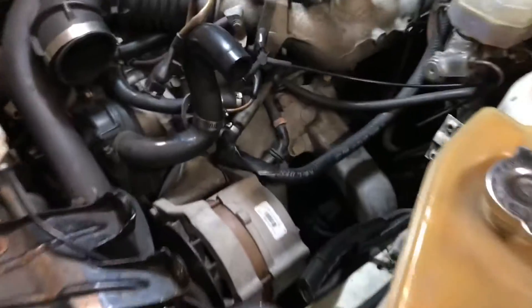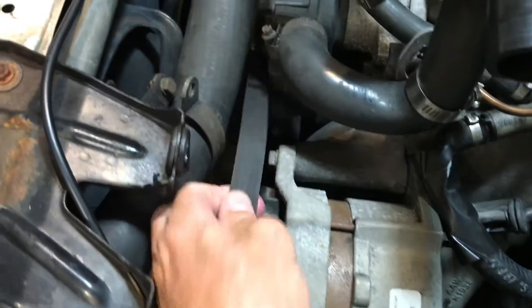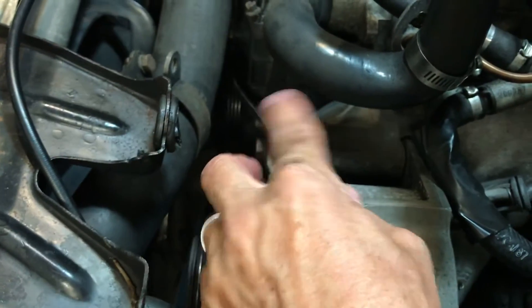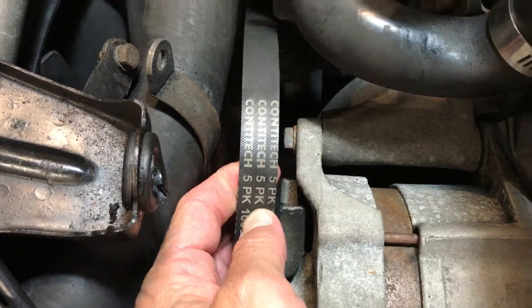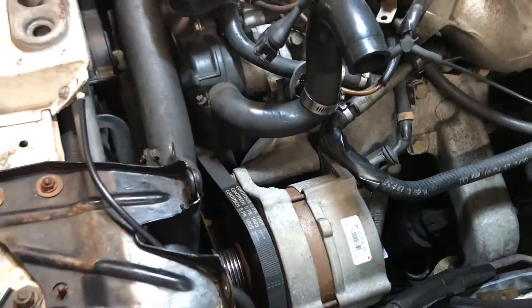I'm going to do it because I need air. Down here underneath the alternator, you've got the serpentine belt. You have to check the ribs of the belt — this one has a number on it. The thing I want to say is: on your 924S, when you put the belt on the cam pulley, make sure it goes on the correct side. You've actually got another groove; you could put it on the back side, but when I did that it made a lot of noise. This belt says 5PK — that is what you want for a 924S. If you walk into AutoZone and ask for the belt for this car, they'll give you a 6-rib belt, which is actually for the 944 of the same year. I think their information is wrong. I put one on once and it slid off, wrapped around my power steering, and destroyed it. Don't do that.